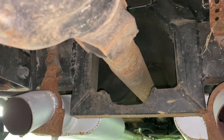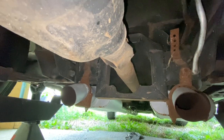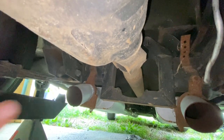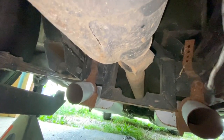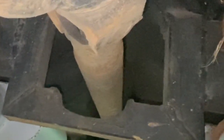Once I got far enough along I chopped out the middle of that two-by-six piece of box tube that went across there and built this custom rear drive shaft loop. I had to C-notch it on the bottom to allow clearance because the drive shaft was a little lower than I wanted. Let's take you to the back of the car — you can see where I cut the frame rail off and just nestled this piece of two-by-three box tube right in there and literally welded the unibody frame rail solid to that.